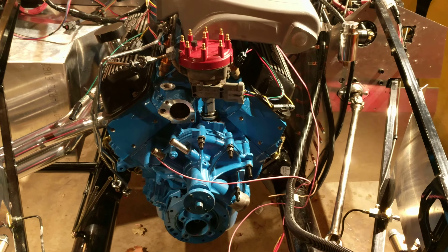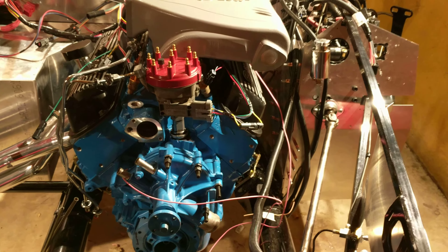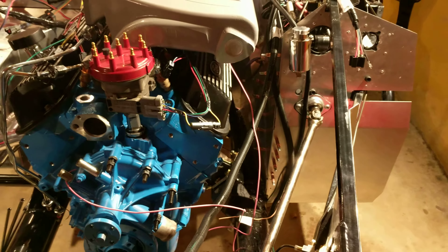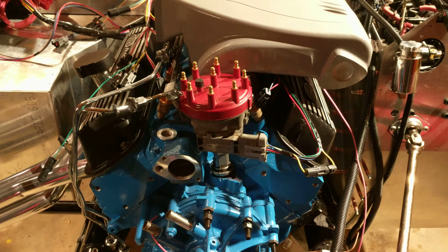Things to remember: I probably need to get a couple more fuel injectors because when I was changing the O-rings, I cracked a little bit of where the plastic piece contacts the actual motor. That's probably not good. There are little buttons I can buy to replace that.